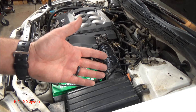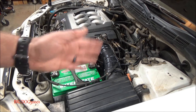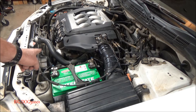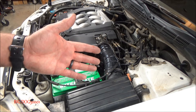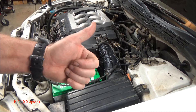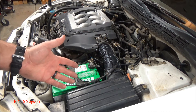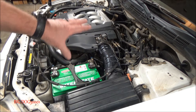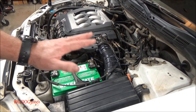It's really easy. All you have to do is turn the vehicle on, make sure all electrical loads are off, and just let it idle for five to ten minutes after your cooling fans come on. Once the fans come on and it's at normal operating temperature, let it run five to ten minutes and you're good. Honda has made it easy, so don't forget this important step — no tools required.